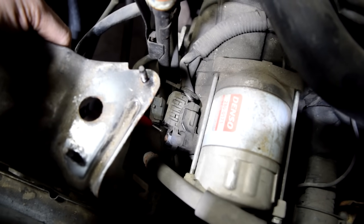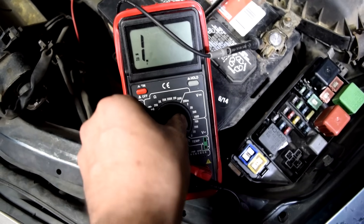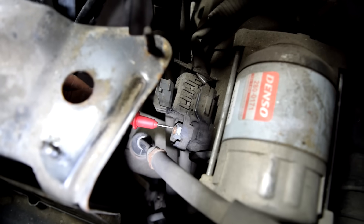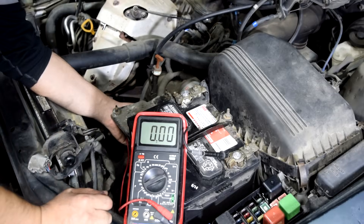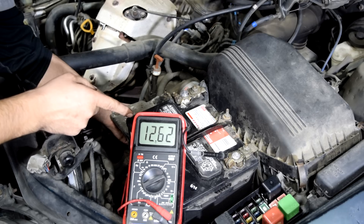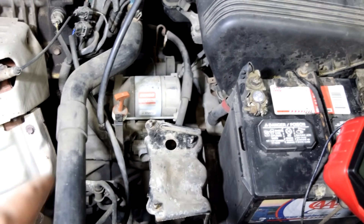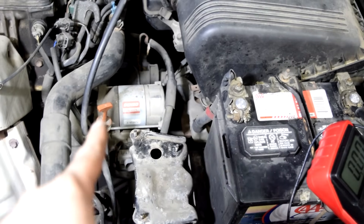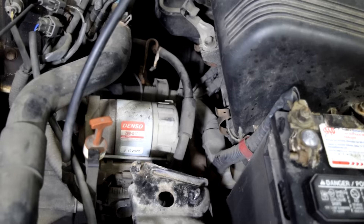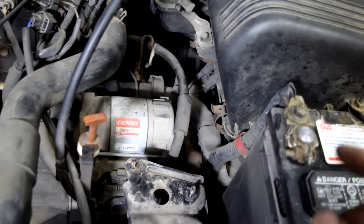Next it's time to see whether we get a constant 12 volts supplied to our starter motor assembly at this post right here. We get our multimeter, put it on 20 volts, ground one test lead, and attach the terminal with our other test lead — our multimeter should show battery voltage here. As you can see we got 12.6, so we verified that we are indeed getting a constant supply of battery voltage to our starter assembly. If you don't have battery voltage there, it means the cable going from the positive post on your battery to your starter assembly is probably pinched or damaged somewhere. Usually on that cable there are no relays or connectors — it's usually a straight shot.